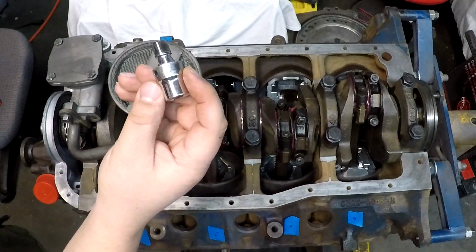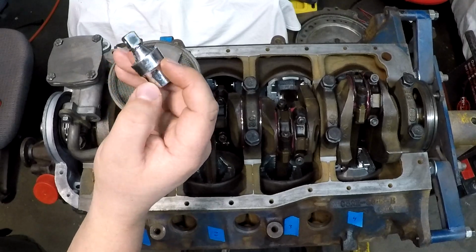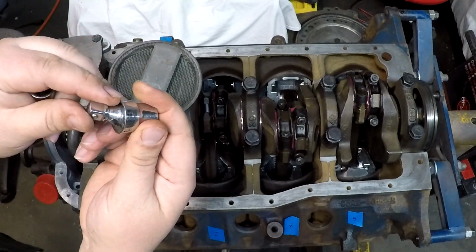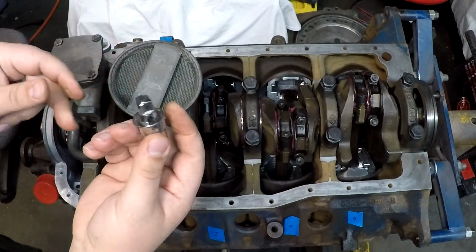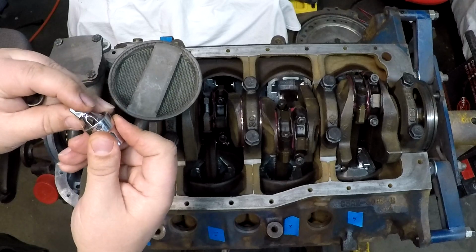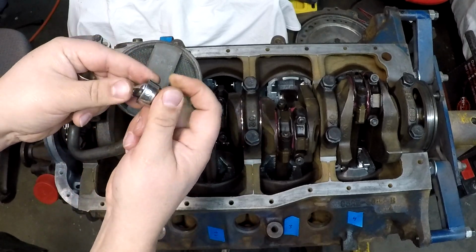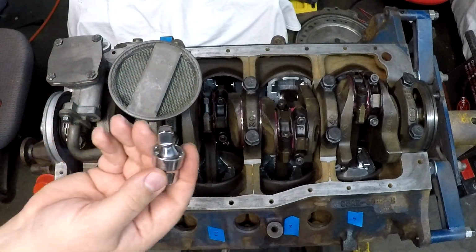And I picked those up from AutoZone many years ago. I think they still have them. They're a Duralast swivel. It's kind of one of the nicest ones I've come across. It's got a pretty heavy pin. If you treat it right, you're not going to break it. It's better than the, what is that, 4-jointed swivel that kind of binds up. I have not had too many issues with this thing wanting to bind. You can run that thing all the way to one side and it will rotate freely without binding. So that has worked out really good for me.